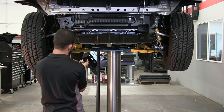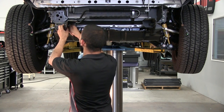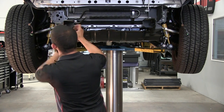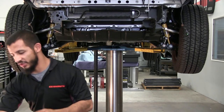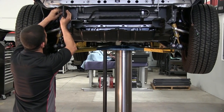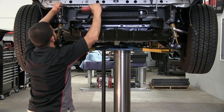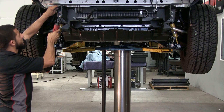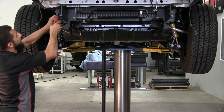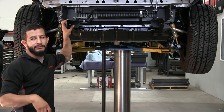We're going to install the carriage bolt. The last bracket for this is going to be the frame bracket, and as mentioned, you have to reuse the existing factory nuts. Now as mentioned, everything is relatively loose. This is going to require some adjustment when you go back to install the front cover. We're going to now install the winch tray, and then from there we're going to go back and finish the install of this bumper.